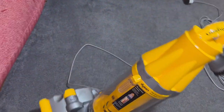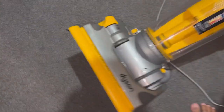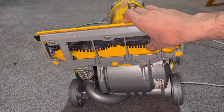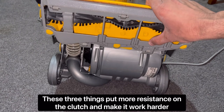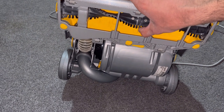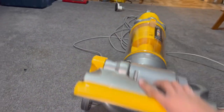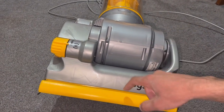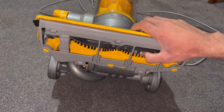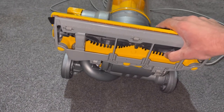This Dyson has a 120-volt motor. I could have left the 240-volt motor in here, but the combination of the very stiff bristles, the wider sole plate letting the brush bar dig in more, and the more powerful 240V UK motor — which produces around 290 to 330 air watts, higher than the 120V version — is too much for the clutch to handle, causing the gears to grind. So I put a less powerful 120V motor in so the brush bar can spin properly with the clutch. These clutches kill a lot of the torque and the gears grind when there's too much resistance on the brush bar.